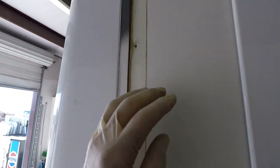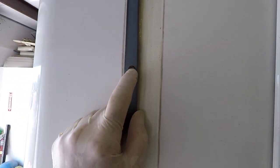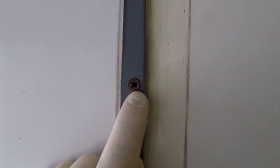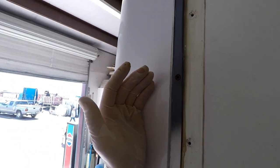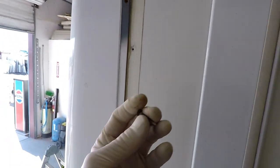Under that trim there are just some more screws. You'll notice this is actually the wrong type of screw because it's all rusty — it's a cabinet screw. Winnebago doesn't use these; the industry standard is square drive or Phillips, and they only use Phillips number two for the most part. So that's already the wrong screw in there. I've got to take these screws off and do the same thing on the other side. You definitely shouldn't use a screw that's going to rust on the outside. Well, since it's been off before, maybe it won't be too bad taking it off a second time.